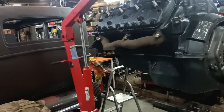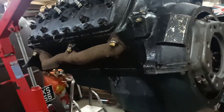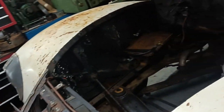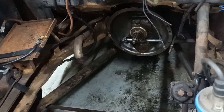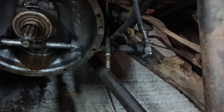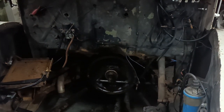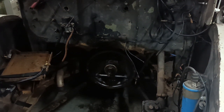I have fitted the manifolds to the French motor with the brass nuts - you can see it's wringing wet with condensation, it's gone a bit warmer today. There's the motor waiting to go in; I've got it suspended up there while I put the exhaust manifolds on. The truck is sort of ready to receive it. I'll get it in contention then shove the jack under the gearbox as it's part way in. I want to remember to fit the oil pressure gauge line and get that anti-chatter rod in as I'm offering the engine in. Let's see if I can get it in.